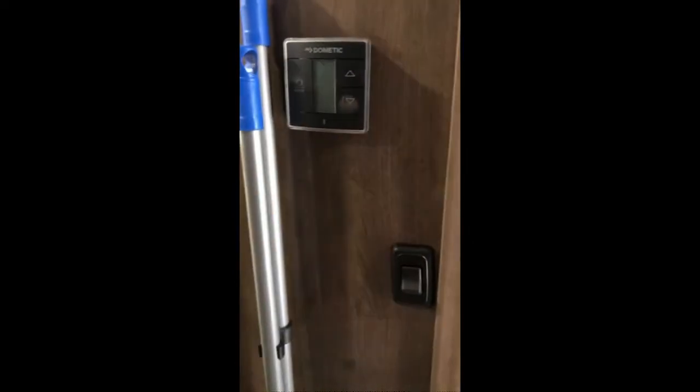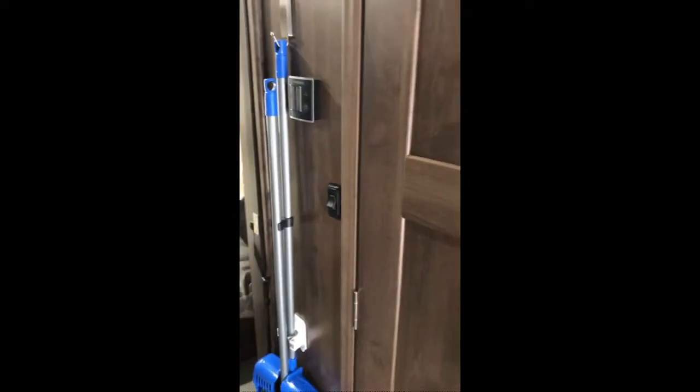We're going to talk about the air conditioning unit. You can find the thermostat right here — we'll cover that in a minute. One of the most important things is that when you're running the air conditioner, you need to have either the generator running or be plugged in to a power source. If you need help starting the generator, please find our video on that. If you're plugged in at someone's house, you need to make sure their breakers are 20-amp breakers. If they don't have 20-amp breakers, turning the AC on will trip the breaker and you won't be able to use it.